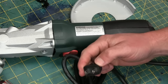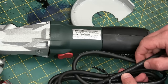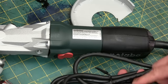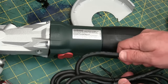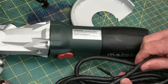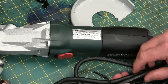A nice power cord. Of course it's a double-insulated tool, so we don't have the third prong for grounding. The cord — real nice. Reefang, I don't know that brand, sounds a little offshore. But 16 American wire gauge — lots of copper. 105°C, that's really good insulation. Feeling this insulation, it feels like natural rubber. It feels just like trailing cable on a piece of mining gear or a port crane — real high quality.